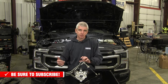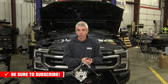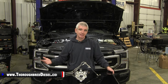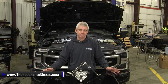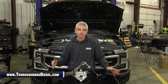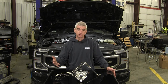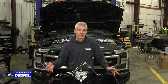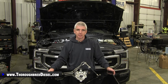With a DCR pump, you will have done a new fuel filter on it as well. So new fuel filter on the truck, and then with the vacated lines, it took me 5 cycles of the lift pump for the truck to start. Cycling the lift pump, without your foot on the brake, the truck doesn't turn over. You just cycle the key one time. Like I said, I did that 5 times. That gave me enough prime. The truck started within 3 seconds, I think.